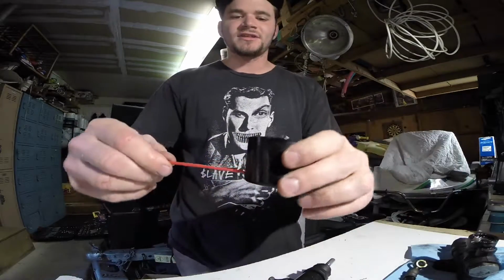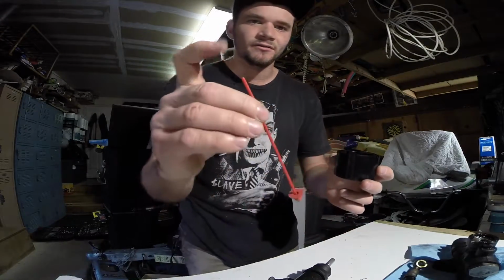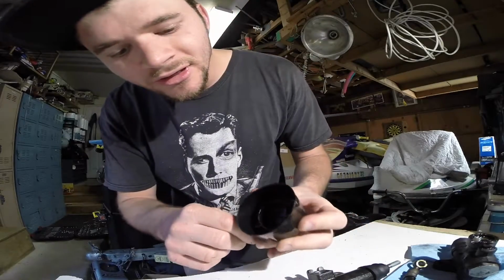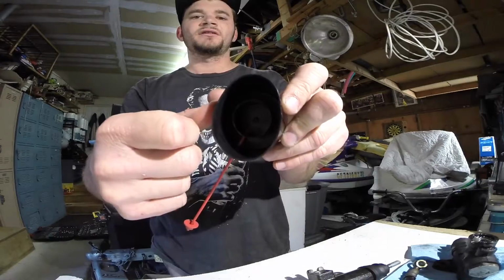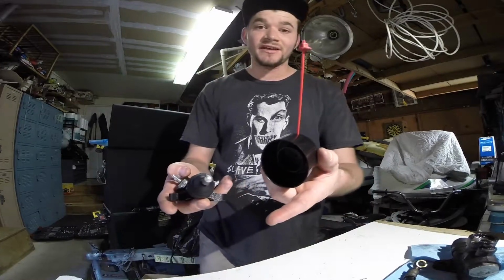And then, as you can see, I also drilled a hole, just a basic cap with the straw, just like you get in any old spray can that it comes with. So I just put the straw in the holes. Notice how I drilled the holes towards the bottom so I can fill the middle reservoir here with brake fluid. So we're going to attempt to prime this with this little setup here. So let's see how that goes.